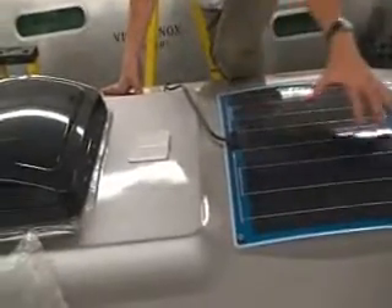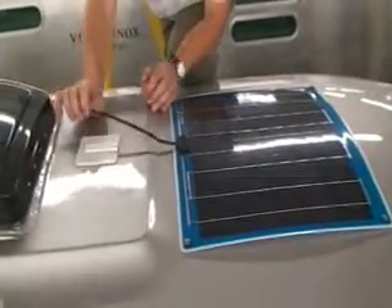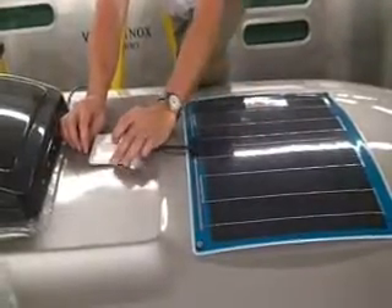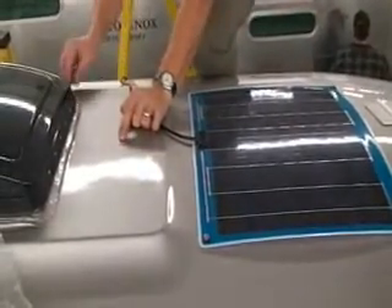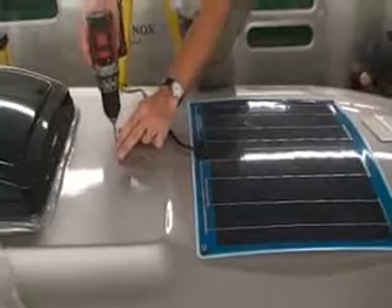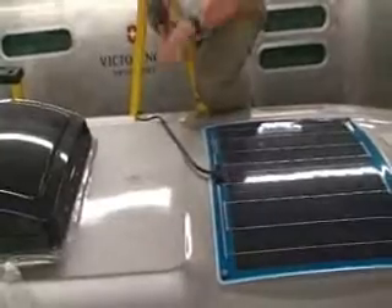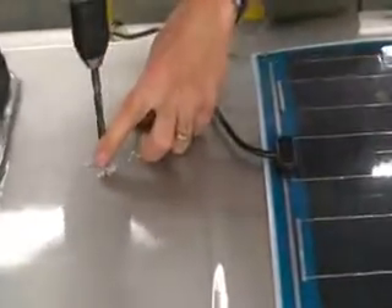Now I've got my solar panel mounted on the roof with all four stainless steel screws in. My cable comes back and I've got a little wire raceway that's going to set over it — so this wire is going to go right down the roof. I've got it marked right here; I'm going to drill a 3/8-inch hole. But before I drill the 3/8-inch hole, I'm going to drill a little pilot hole right in there, then come up with my 3/8 drill bit and finish drilling my hole.